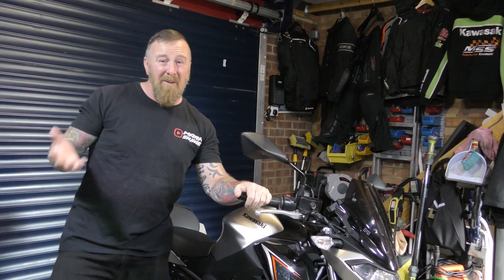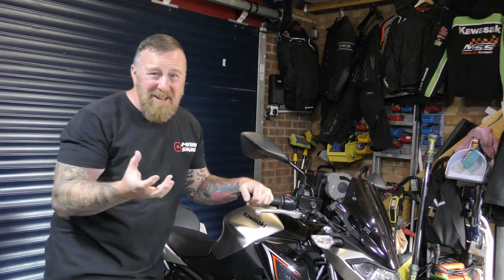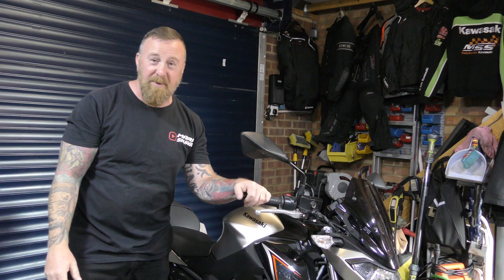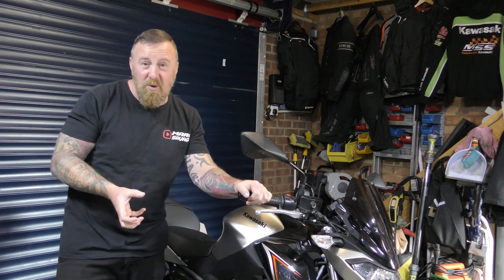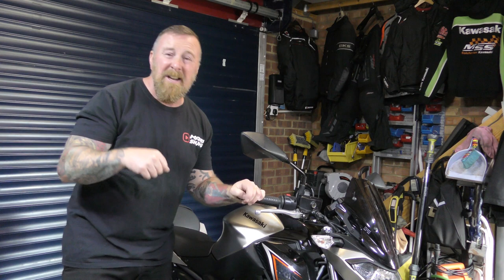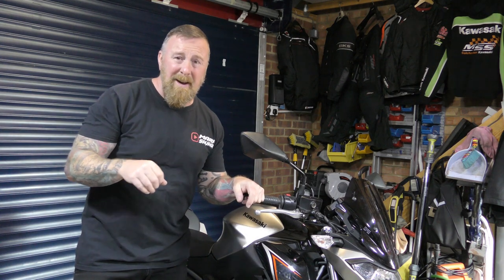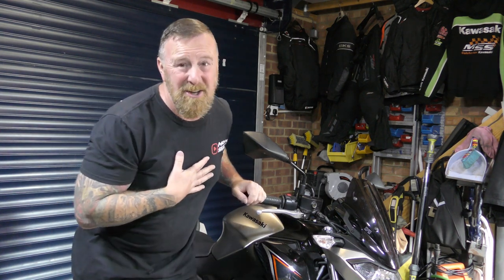The alternatives aren't much better. It's got that twin pop — not like a Ducati. It's got more of that annoying 125 blah-blah-blah noise, you know? Unless you get a really expensive exhaust to get a bit of rasp out of it. If you're going to change the exhaust, there is the O2 sensor you have to worry about. Don't get an eliminator — they don't always turn the FI light off. Try and get one where you can put the O2 sensor back in with a pipe. But personally, it's just not worth it.